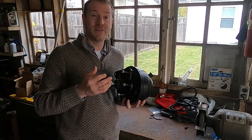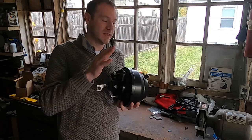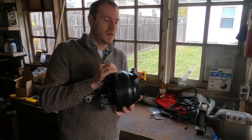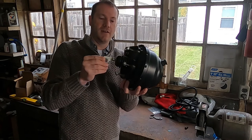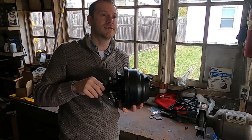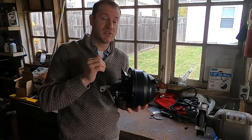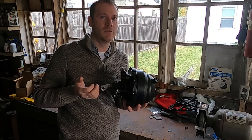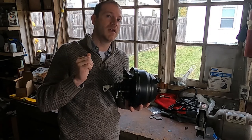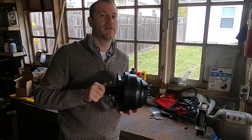One thing I wanted to add: I mentioned a few times that I didn't have good brakes — so what does 'not good brakes' mean, and how do I know it was the power brake booster not being strong enough versus something else? What I would have was a nice-feeling brake pedal — linear, didn't feel spongy, just felt like a nice boosted pedal. Only nothing would happen for about halfway down that pedal. Then suddenly the brakes would immediately get firm — not spongy, just firm. The pedal wasn't super hard, but it was much stiffer than it should be, and that's where braking started.